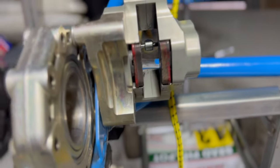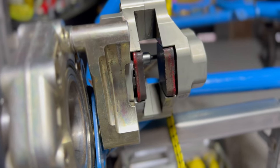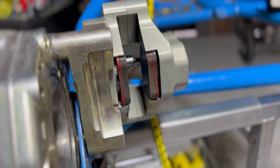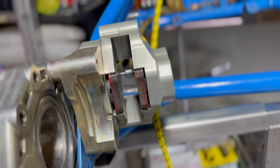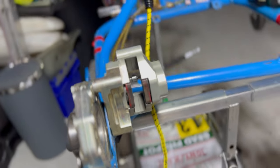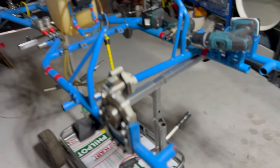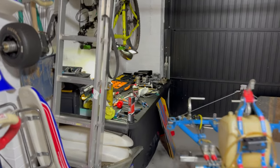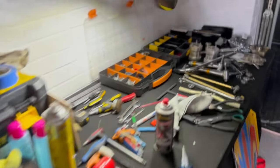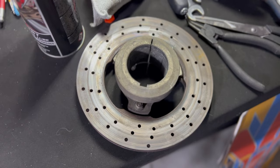That is now a functioning brake caliper — the pin is fresh, the pads are absolutely fine. I haven't changed them because they're official OTK red pads and they've got loads of life in them — probably at least two years. The pistons slide in and out really easily, everything's clean. To finish off the brakes though we need to renovate the brake disc, which is over here looking a little bit sorry for itself, so we'll get to that shortly.